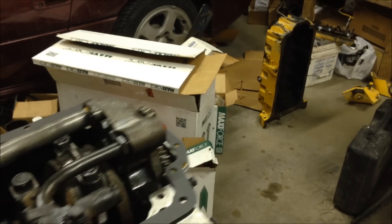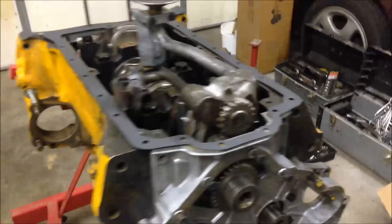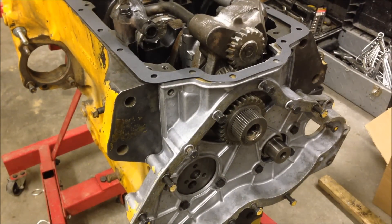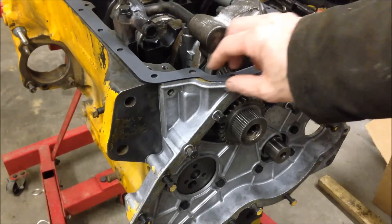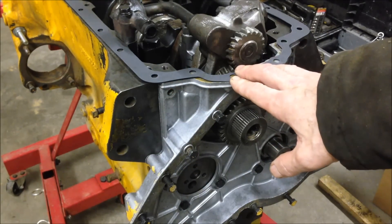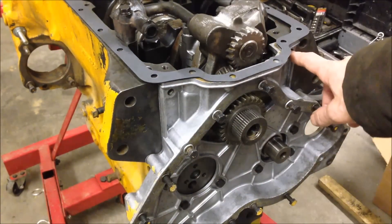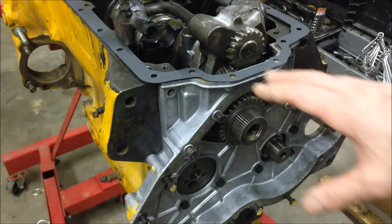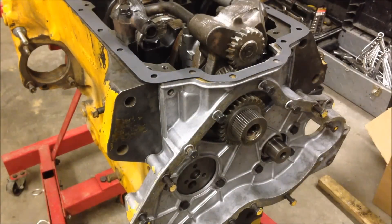Taking a quick look at the front of the engine — you can see you just have the front cover on. I like to get everything on together loosely, because this flange right here mates with the oil pan. So you want to get your screws started, get your gasket and everything set up, and just let this stuff float initially when you put your oil pan on. Then, once you've got everything kind of in place, you can work it on down.